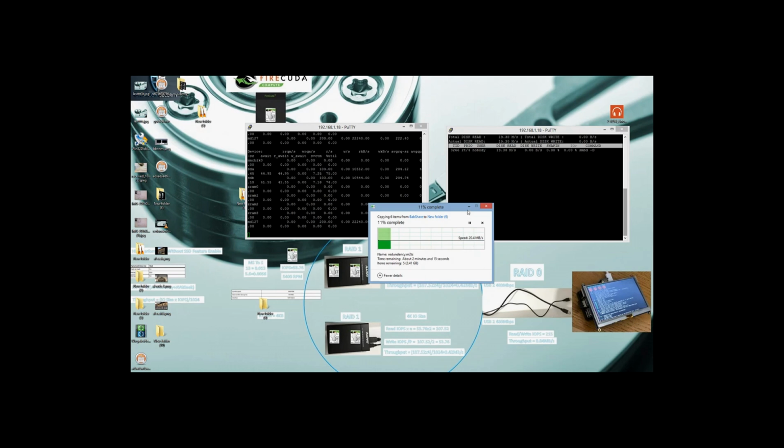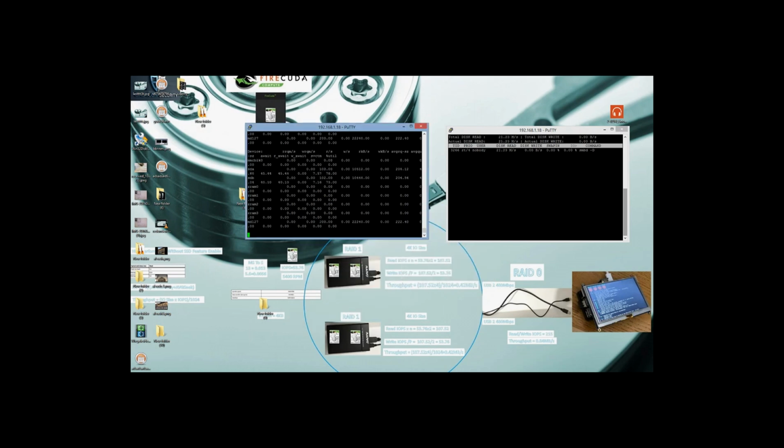one of the enclosure hard drives. Additionally, we can see that the read IOPS is the same. If we look closer at SDA and SDB, which represent both enclosures, we can see the same amount of IOPS. How can it be? How can it be that after we extract one of the enclosure hard drives, it's the same amount as the second enclosure, which has two hard drives? So we can conclude from it that the Maiwo enclosure takes just one hard drive when we do RAID 1, and just takes the performance of one of the hard drives.